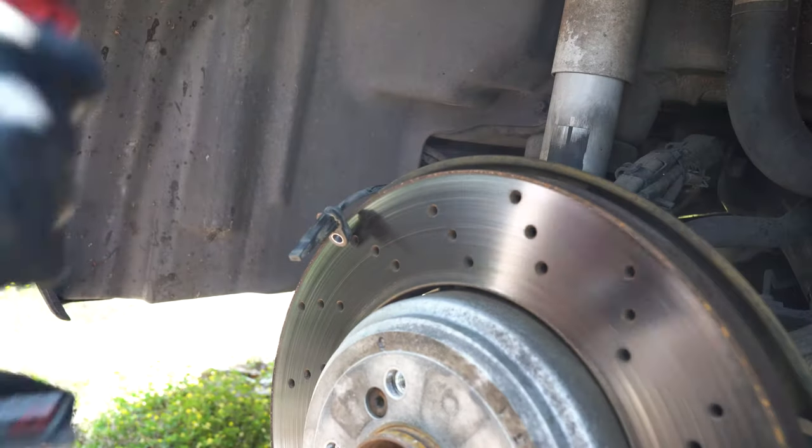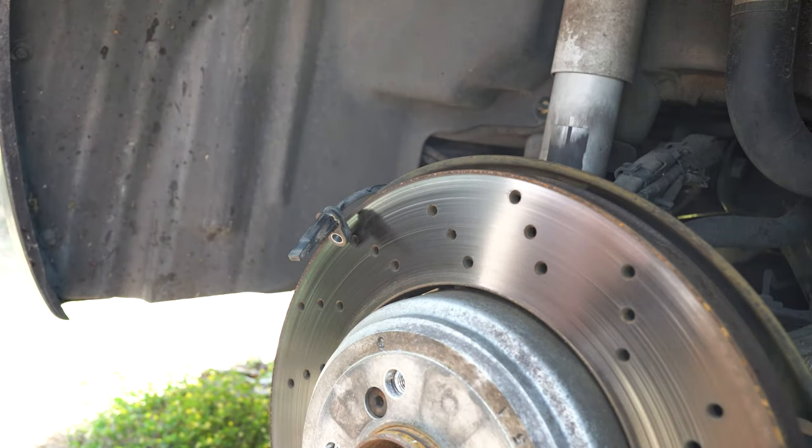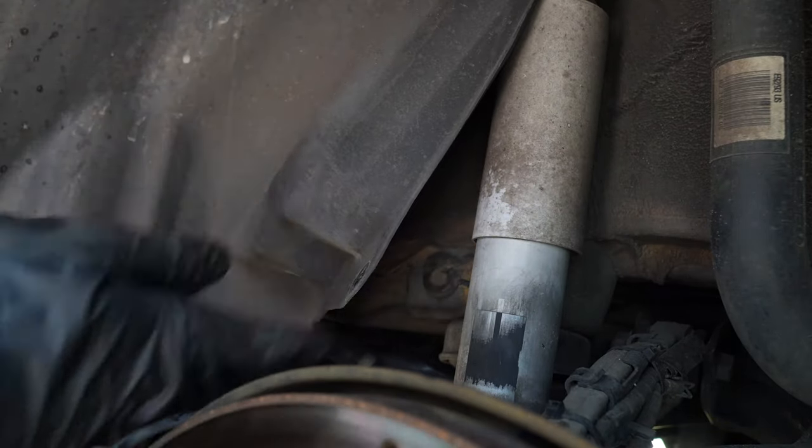The next step is a 10mm right here, which is the plastic one, then an 8mm down at the bottom, and another 10mm. So we can see the harness coming from there and that portion is sitting right there. It's really hard to see, but we have our connectors — basically popping them out. We want to get the gray connector push-pin knobs at the top, press at the top, and try to undo it, which is going to be pretty tight because they're rubber. The other portion of the connector we can definitely reach from the front.